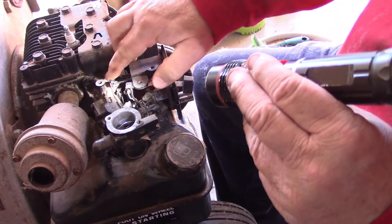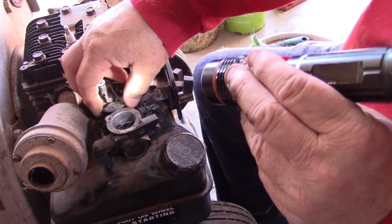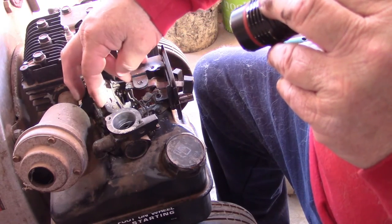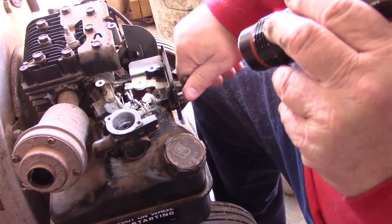So we're functioning there. The governor is connected, and it's spring-loaded. You can feel a spring. You can see when you spring-load it, and it wants you to shut back off again. So that's all working perfect. So basically, the motor is back to where it needs to be.